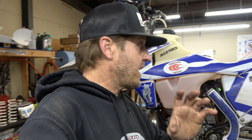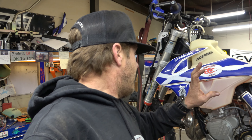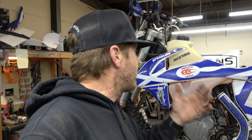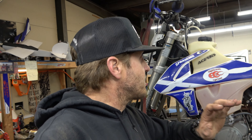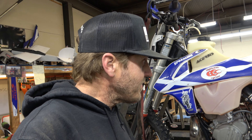I'm going to stop this video now because I'm going to have another whole video of us out testing this thing with this jetting in it. To recap what we just did: we put an RK Tech head on this thing set up for 6,000 feet for a guy who wants to run pump gas. I'm going to be running 40 to 1 oil mix — I usually run 50, but Kelsey asked me to run 40 so I'm going to do it. We've got a 410 main jet, a 35 pilot, the JD Red Needle in number 3, and I think I'm ready to go ride this thing. Make sure you join us as we test it — if we need to do any more tuning on the carburetor we absolutely will. I hope you guys get out and spread the gospel of two wheels, and I desperately hope that what we're doing here is inspiring you guys to work on your dirt bikes!